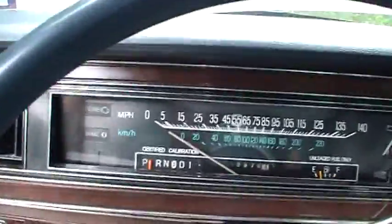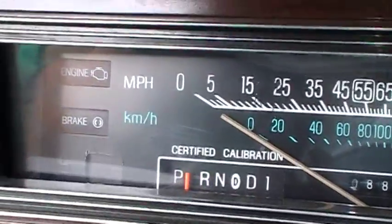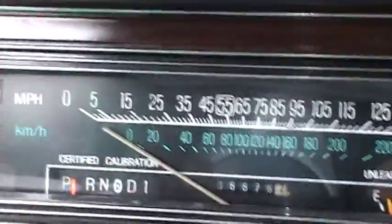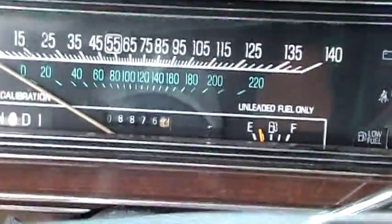When it actually flashes on the check engine light, it will flash half of the numbers of cylinders that the computer is rated at. So what it wants you to do at that time — when the light flashes, or when that eight comes up on the display — is step on the brake and turn the wheel 180 degrees and turn it back. Then you just let it go through its cycle, which shouldn't take more than about a minute or so.